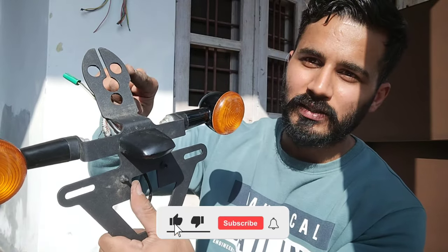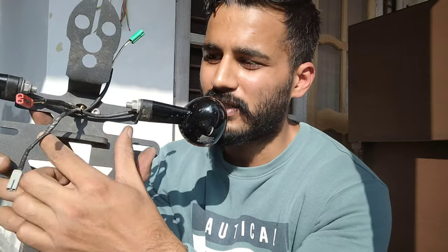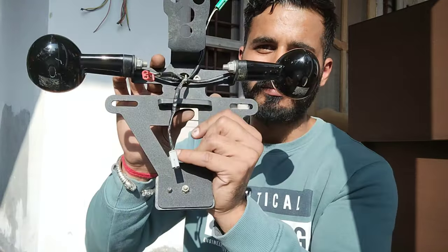Back again — my setup is ready. There was a slight issue: when you buy a tail tidy, you will have to bend it, otherwise it will not fit properly on the bike. I had to bend it, and I will tell you that you may also have to remove something from your old tail. I used a rubber band to help touch the fender from behind. Everything is almost ready — I have mounted everything on the side. The backlight is mounted and everything is in place.